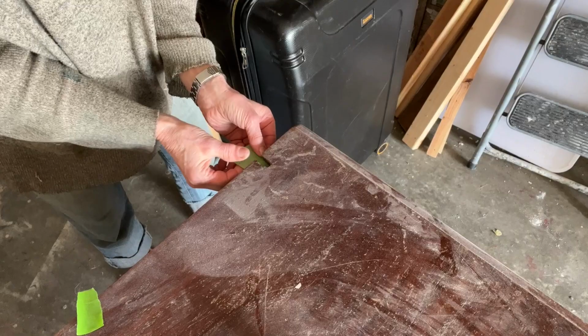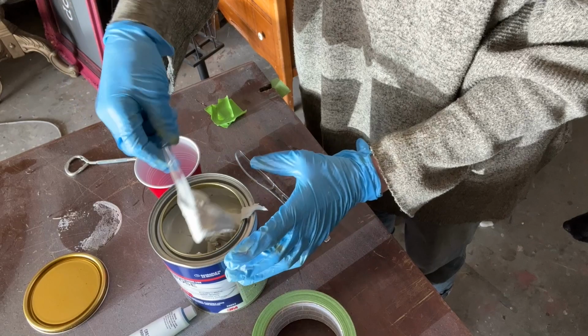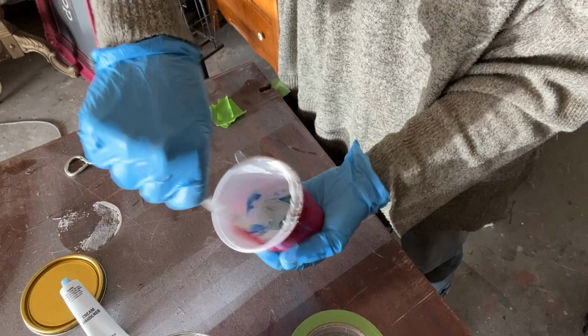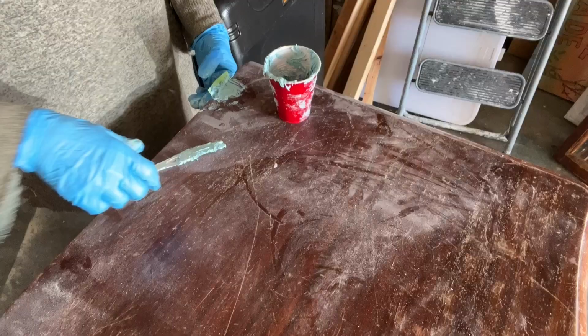This is a hardening cream. You have to mix it with a little bit of the hardener. Wear gloves and a mask. You can sand it when it's dry, but it's super smelly. Bondo is also really great for deep gashes when you just can't sand them all out or filling things like this. Be sure to spread it really thin and scrape up the excess.